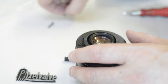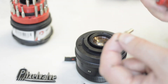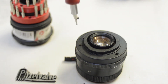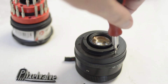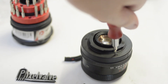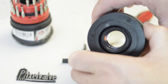Allen keys are readily available and you probably already have one. I like to think of this like a car wheel — don't tighten one screw all the way at a time. Instead, loosely tighten them first and work your way around, then go back and finish tightening them. I'm one-handed here so it's a little tricky, but it'll be a lot easier for you. Once you're done, check the lens — move the blades, move the focus wheel, and if everything clicks and feels okay, it is okay.